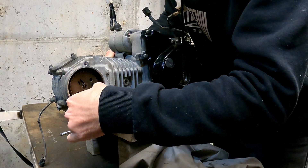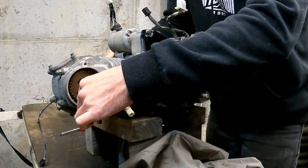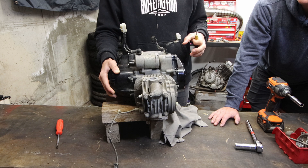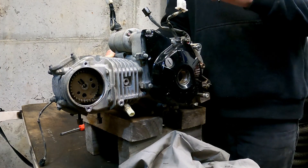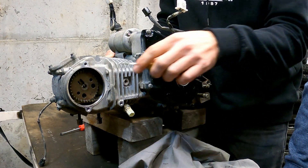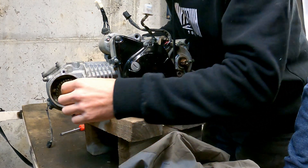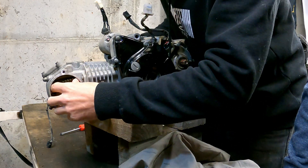What happened with the MSX125 engine from Kevin in the end? Remember how it munched through like three sets of cam chain rollers? The sprocket on the cam — they had taken the sprocket off the crankshaft and when they pressed it back on they didn't press it on all the way. It was in the wrong position so the cam chain wasn't running true and it was just mincing the wheels off. As well as the whole timing for the engine being out because it wasn't put back on in the right spot. I knew when I got it into my hands that it needed basically a new rebuild. It ran, but it sounded like nails — a whole bunch of nails and stuff that shouldn't be in there.